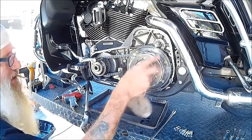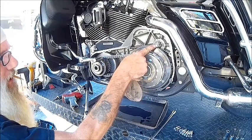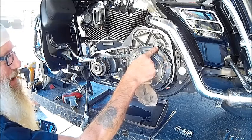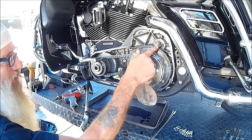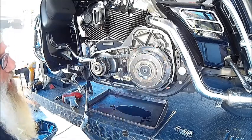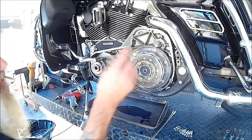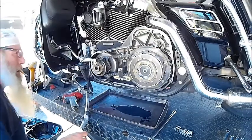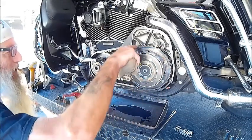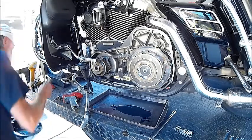This is the alternator. There's a clutch basket, and up here you'll see the Bendix drive — it has a bolt on it and a lock washer. If you can get a new lock washer, go ahead and get one; otherwise, just be careful bending it back. I might be in trouble since I'm not sure if I got a new one last time. I'm going to fold part of this over to make it work. There's a detent here, and I'm going to take that apart now to release the Bendix drive from the starter. You might want to check your ring gear as well — make sure the teeth are good, they're nice and square, that nothing's been slipping or grinding on it. You might as well take a look at everything while you have this cover off.